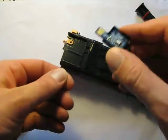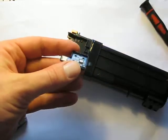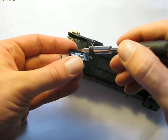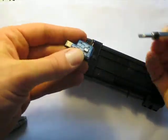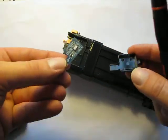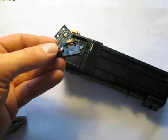With some programmers you can simply stick this into the programmer. Otherwise you would have to take out this small chip here, and we do that by pushing this tab back — pushing this piece of plastic back while twisting the chip out. And there you go, that's how you take out the chip from a toner.